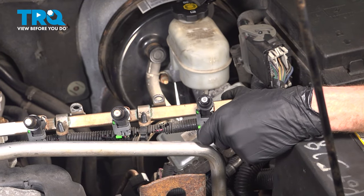Now it's time to carefully reinstall the vacuum hose that leads to the vacuum booster for the brakes. Squeeze the clamp and slide it onto the intake — be careful not to break the intake or the hose. Press the hose as far as you can near the intake, then bring the clamp down into the original position; make sure you have hose on both sides of the clamp — if it's off the very tip of the hose, it could potentially slide off, which is dangerous. Now it's time for the MAP sensor — put it in position, align the two locking clips with their corresponding holes, and slide this down. Listen for a click from both sides; give it a little wiggle — it should be able to move around a tiny bit but shouldn't be able to lift up and out.